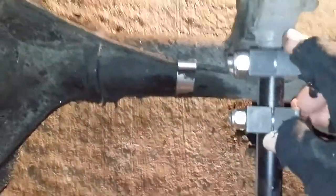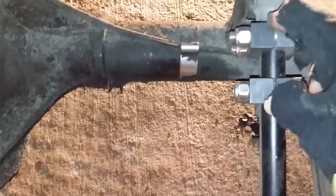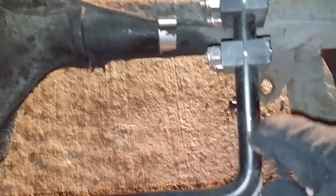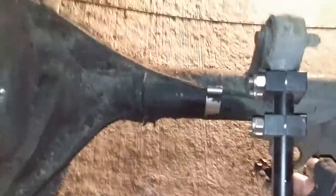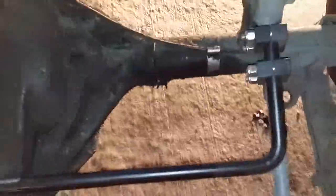The whole design of these Harvey Bailey anti-roll bars is bad. I've put these clamp bars at the very end, as opposed to what's suggested — having one here and one there. It makes no sense to have the load that far up on these tramp rods. What you're really looking for is just one clamp here, and then the best thing is to connect directly onto here. So these need to be modified.